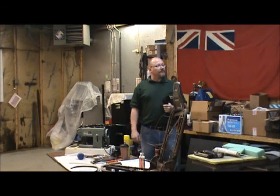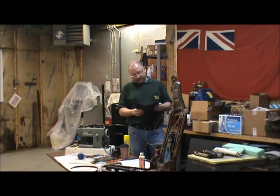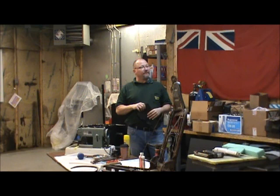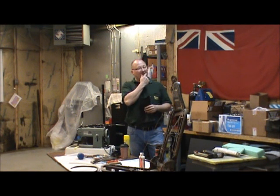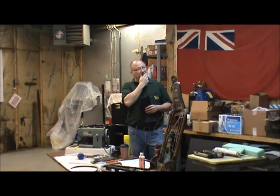Yeah, and you need a special gun. Of course, why would they make it easy? You need the gun, the tool to put the cartridge in to do it. I don't think you could sit there with your two thumbs and push this stuff through and make it come out, because it goes into a straw, and the straw actually stirs the product. Gives you a lot more time to play with. Yeah, you have about 15 minutes probably with the adhesive to do that. And the 1300, depending on the temperature that you're doing it in, you might have 5 minutes with that stuff.